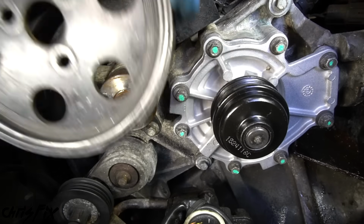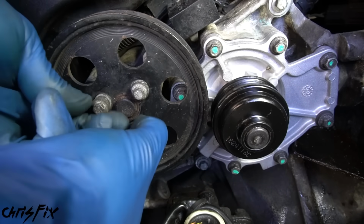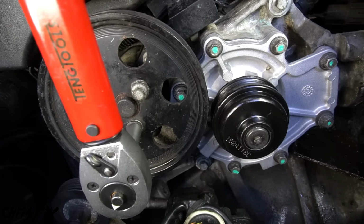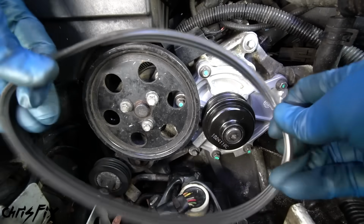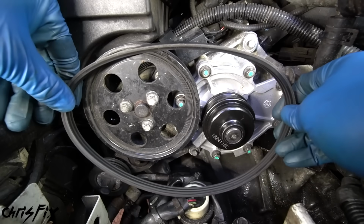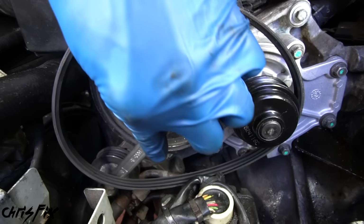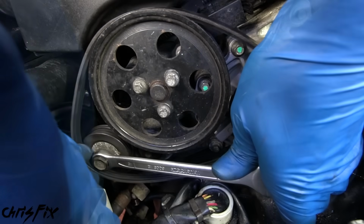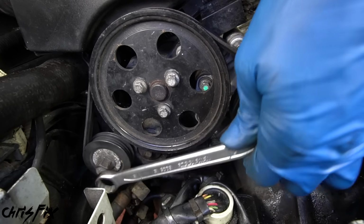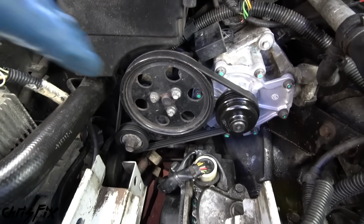It's that simple. Now let's real quickly get that other pulley in place and then hand tighten the 3 bolts that hold that in, and each of those bolts do have thread locker on them. These get torqued to 8 foot-pounds as well. Good. Next we could add our belt, and now's a good time to replace your belt if your belt is old. This is actually pretty new. I replaced it last year and it's still in good shape, so I'm gonna reuse it. So let's just get this around 2 of the pulleys. Get a wrench on our tensioner, loosen the pressure on the tensioner, and slide the belt over the pulley. Good. And you just want to make sure that the belt is centered on each pulley and not riding along the edge. And that looks good on all 3 of those pulleys. So we are done over here.